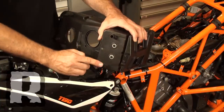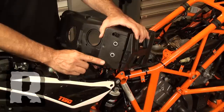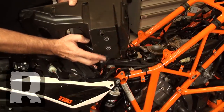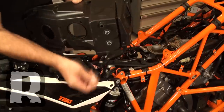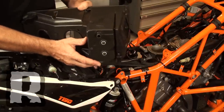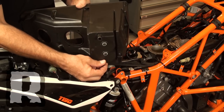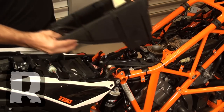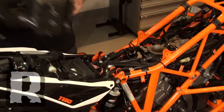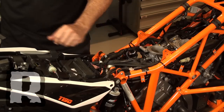The other thing we didn't mention because you couldn't see it from the camera angle is there was another little hose coming out of the air box on the left-hand side right here — it's just a drain hose for anything that gets in the air box, and it's plugged on the bottom left-hand side of the bike. It just kind of pulls right off and the whole bottom of the air box will just pull right out after that. At this point you're basically ready to install your entire Power Commander 5.